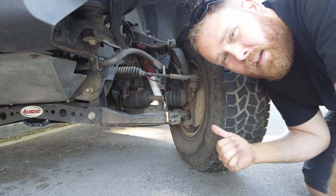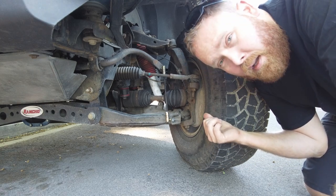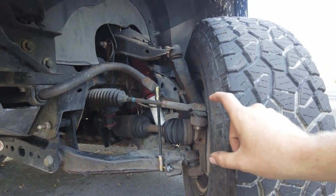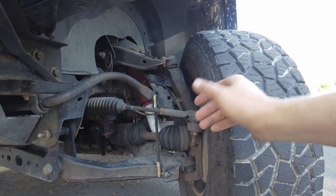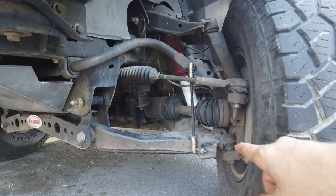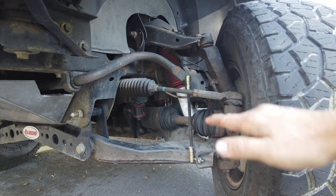Before I give you guys the answer, let's head out to Ryan's truck and take a look at his lift kit and how it differs from some of the lift kits I've got here on the bench. So what is a lift spindle and how does it work? This is a four-wheel drive lift spindle for this GMC Canyon. The relationship between the ball joint, tie rod, hub, and upper ball joint all work differently than the two-wheel drive spindle. By dropping the lower control arm mount, the hub, and the lower ball joint all four inches lower, the tie rod and upper ball joint can stay in the stock orientation.